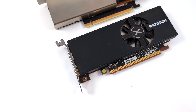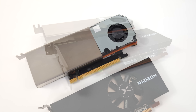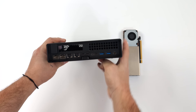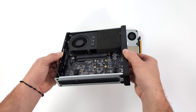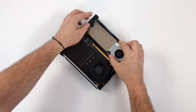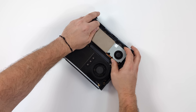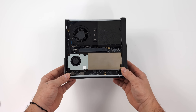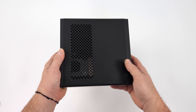The A2000 is really going to far exceed the performance of the RX 6400, but we do need a small form factor unit for this. Of course you could put it in a larger PC, but the whole point of slimming it down is for something like the Minisforum MS-01 — the 13th Gen model with the i9-13900H mobile CPU. Inside we've got a PCIe x16 slot, and we needed that low-profile single-slot card to fit. The A2000 doesn't require any extra power connector — it draws everything from the PCIe slot, no 8-pin needed. It slots right in and fits perfectly in the MS-01, with access to all the mini DisplayPorts. Fresh air can be pulled directly into the blower fan on the GPU once the cover is on.